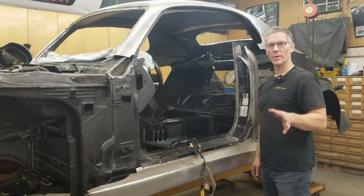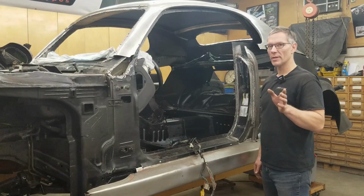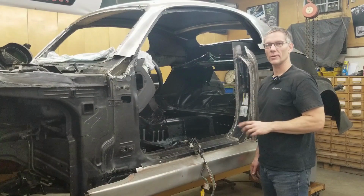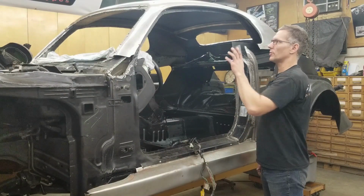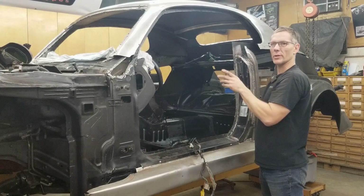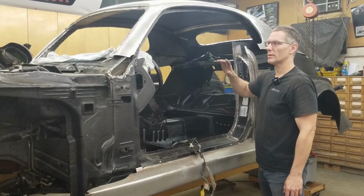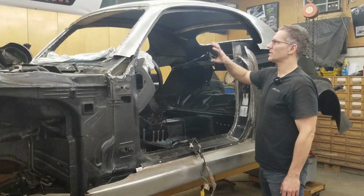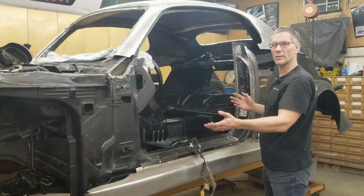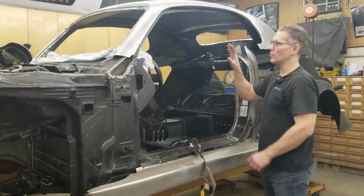Okay guys, grab a piece of paper, notepad, pen, pencil, Sharpie. Sharpie would be great. And let's start making a list of everything we need to do before we finalize that flange up there. You ready? Okay, so to get that flange finalized, we have to mount the rubber seal. Before we can do that though, we have to get the mock-up glass, the templates we created earlier, moving up and down and set into the proper locations. However, we don't have any doors, so we have to get the door shells installed, get the power packs installed, and then we can mock up the glass.